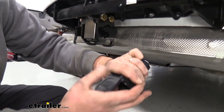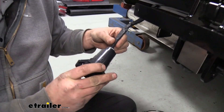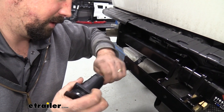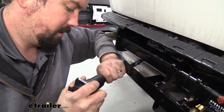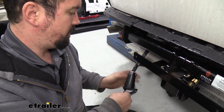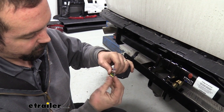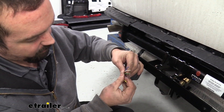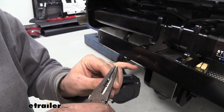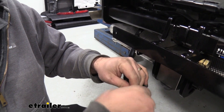What we can do here is take this section and slide it up, passing our wires through. This sleeving is a little bit stiff, so you may have to give it a little pressure as you go along. You should have enough here to where we can at least attach our wires. Now we are going to be splicing all of these ends off, so go ahead and get your strippers here. Make it about that long, splice those off, and go ahead and do that for all the wires.